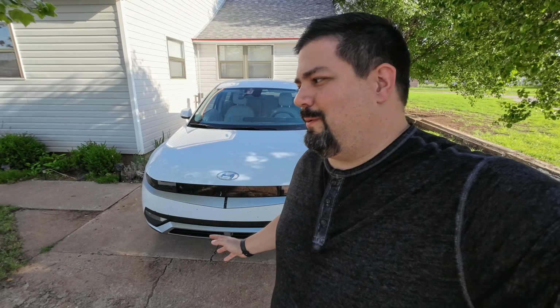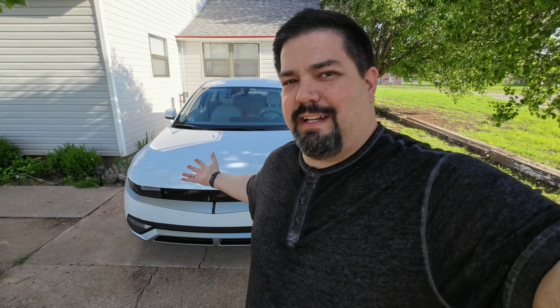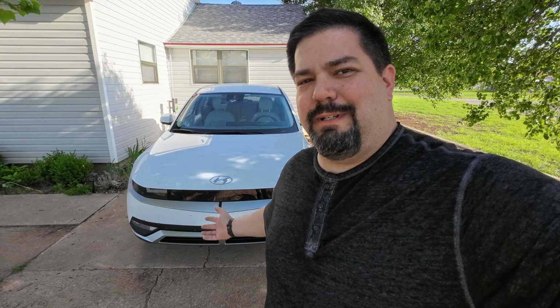So while I was waiting for my car to charge, for me to be able to leave, but now I can't because it's too late, I did do some research, and evidently this is a known issue. There's a service bulletin out. But you have to go into Hyundai to do the software update. And from what I understand, they don't actually fix anything. All they do is limit your charging somehow. So that's not really a fix. I can limit my own charging. Hyundai, we need a real fix here. We need you to get on the ball and get us some 48 amp charging. Even when it's hot outside, we need to charge.